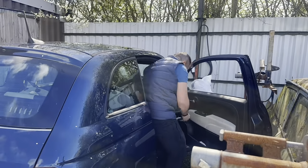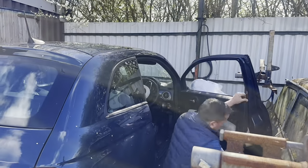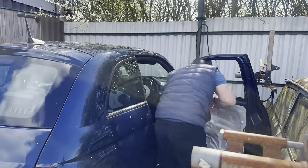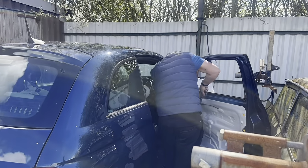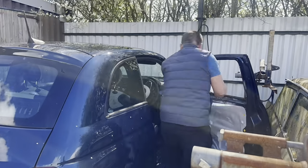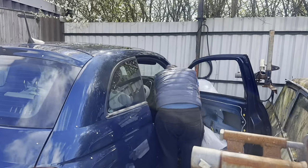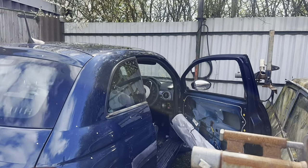And then moving on to the driver's side door panel, I can hear straight away, as soon as I open that, there's a load of glass in there. I've took off these Fiat 500 door panels more times than I can ever remember. Nice little cut there along that panel, try and save it. You don't just want to rip that off, put the door panel on after. It makes an awful racket, bit of time and it's...